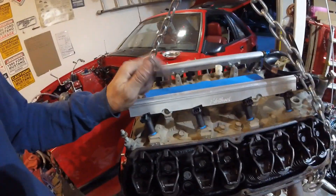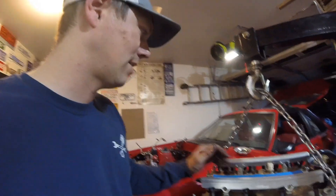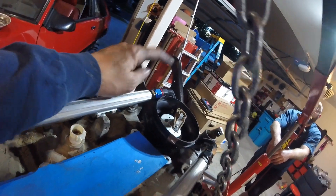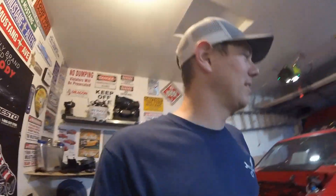This is a factory lower intake manifold, and the fuel rail you have to use is the one with the slanted injectors — if you use a straight one they're cheaper, but you can't on this, so we had to use that. We had to adapt up here to go around the distributor and we're touching a little bit here but we'll be alright. For the upper intake manifold — man, that's going to be a gem, I'm super excited. We're cleaning out the upper intake manifold and once you see what we've got going on it's going to be a thing of beauty. Alright, we're going to drop the 351 in this bad boy and fire this up tonight — it's happening.